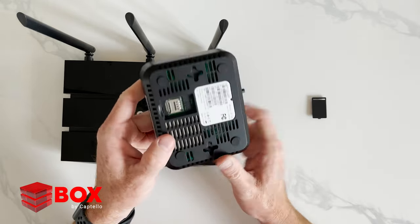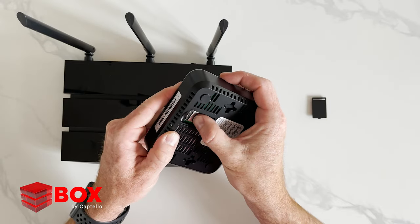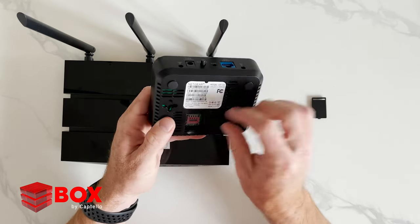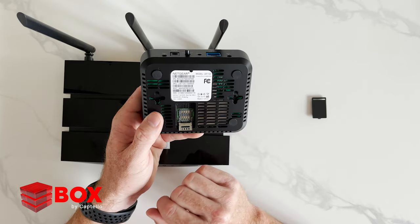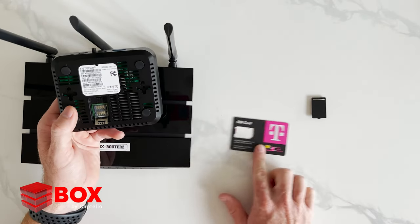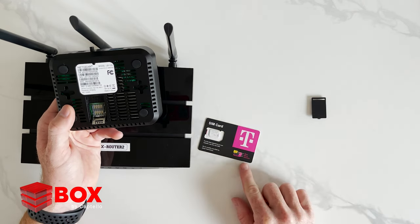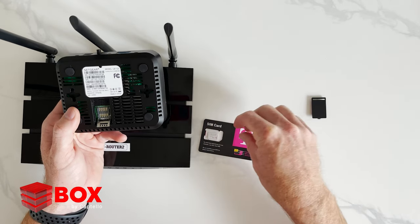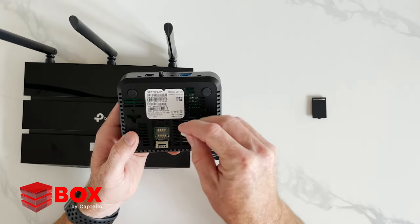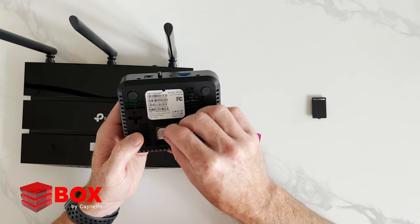You can see some labels right here — it says open and lock. To open it, you want to put this panel up. To lock it, you would simply shift it down and it will lock in place. To open, you shift it down and pull the top of it right there. You're going to put the SIM card there. Your SIM card will come in this area and you can punch out the outer area — here you see nano, micro, and standard. We're going to go ahead and put in a micro right here, and place it in. You're going to see the edges right there.